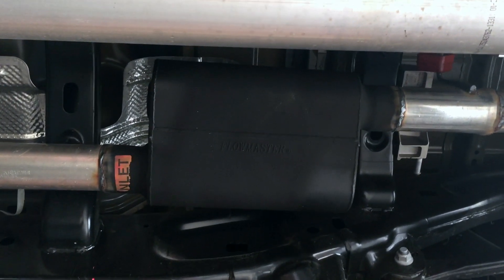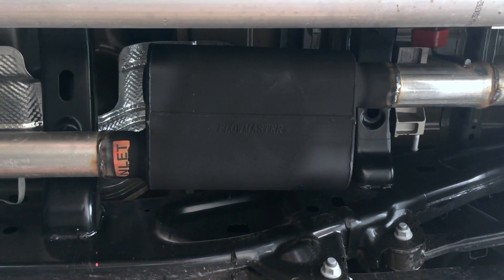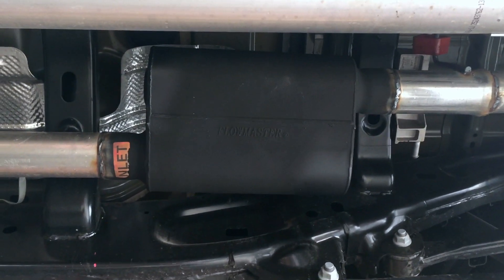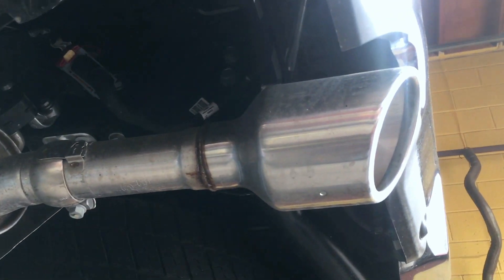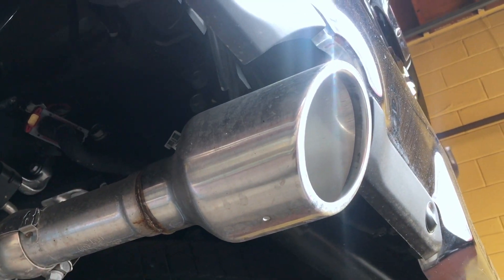The real question is just how loud do you want it to be. We wanted to go right down the middle — the 44 series is a little louder and more aggressive than the 40 series, but not quite as aggressive as the 10 series. From there we put the muffler on and left everything else stock. Since this is the first truck we've done we're not really sure how it's going to react, but I think you guys are going to like it. So without any more explanation, let's go ahead and get it turned on and see how she sounds.